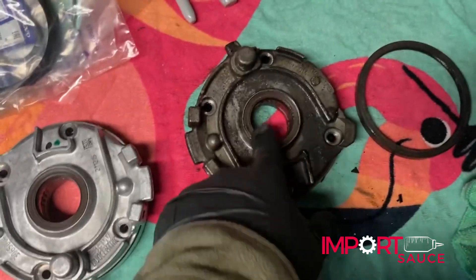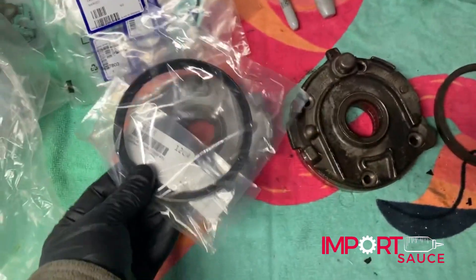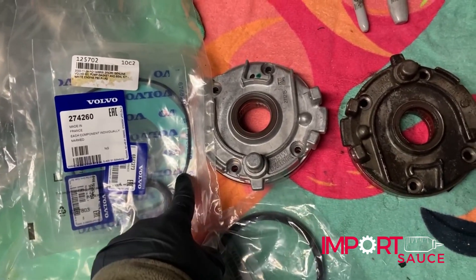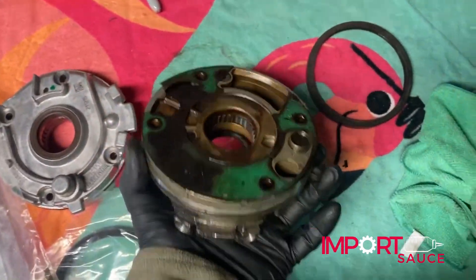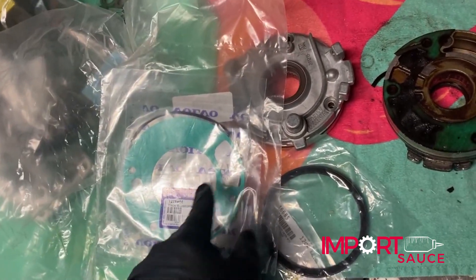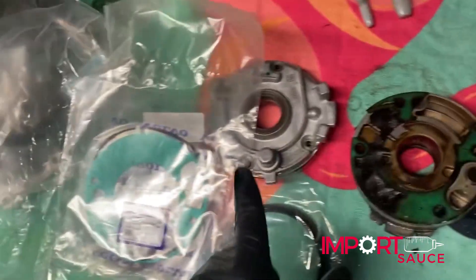The part looks the same and we also have the seal there. So it looks like the new pump came with the seal and the gasket O-ring. We have the new rear main, replaces that one. And then we bought this kit, which is the complete gasket kit for this. It comes with the new insert seal, the seal for the outside, as well as importantly the paper-ish gasket that goes on the back. So it looks like these other two will be extra because this one already came with it.